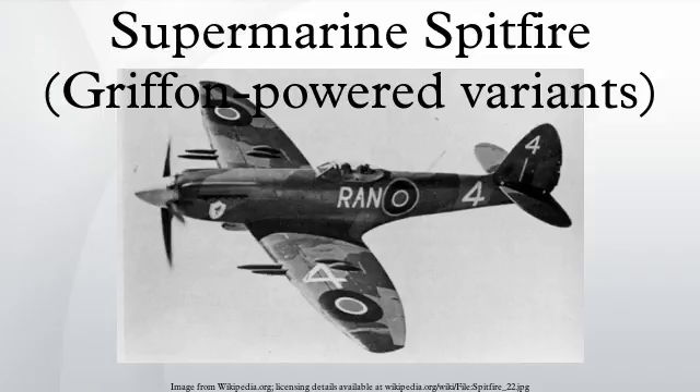As the Spitfire was no longer to be used as a night fighter, the retractable landing lights were no longer fitted. The D-Type wings were specifically made for the photoreconnaissance Spitfires, including the PR-19. No armament was fitted, and the D-shaped leading edges of the wings, ahead of the mainspar, were converted into integral fuel tanks, each carrying 66 gallons. To avoid the expansion of fuel in hot weather damaging the wing, pressure relief valves incorporating small external vent pipes were fitted near the wing tips.